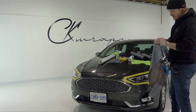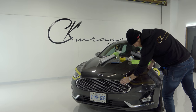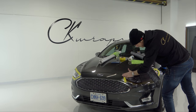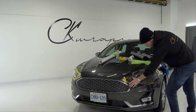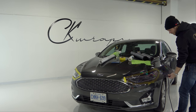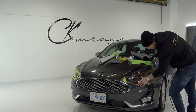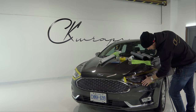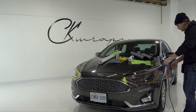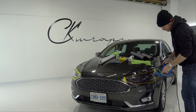Let's take our tint and apply it to the flat section of the lens, right about there. I'm going to anchor that corner down — very important to get those corners anchored down. Let's squeegee out a bunch of this. This new stuff feels really nice — it's way less tacky than the older stuff from Vivid. Now we're going to contour it around the lens, then cut it out and do the other side.